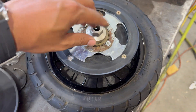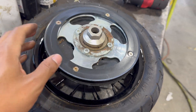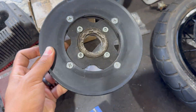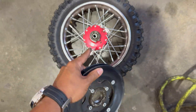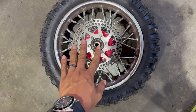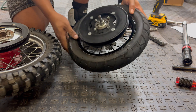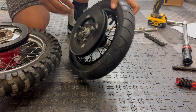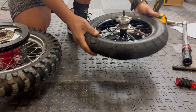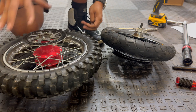I'm taking off the original freewheel and sprocket because I'm suspecting it to be bent, and I'm putting one on from my SX 500 — I just stole it off the stock rear wheel. I'm also going to be taking off the 140mm rear rotor and using that on the Pocket Mod. It definitely spins a lot straighter now.